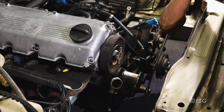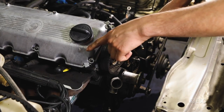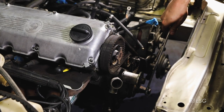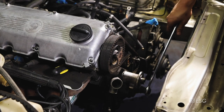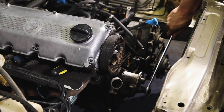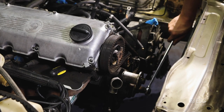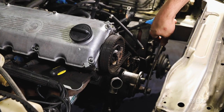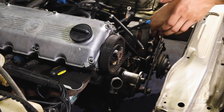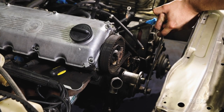The mark is getting closer on the crank - it's almost lined up with the little triangle groove. The only way to know it's at top dead center is this screwdriver is going to rise up, and as soon as it stops rising and the mark is lined up with the groove, the camshaft is at top dead center on cylinder one. Continue turning it and watch the screwdriver go up - almost there, and a little bit more and we'll be at top dead center.